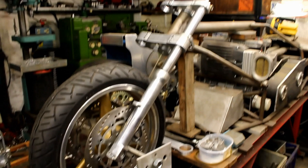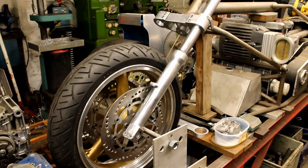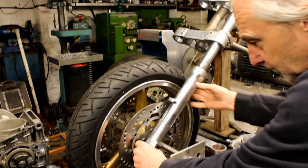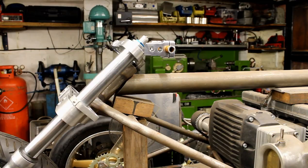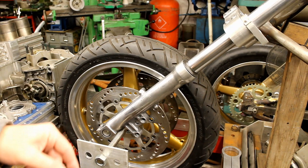The current angle isn't correct - it's just sitting in there loosely. Looking at it as-is, the wheelbase is about 98 inches, which is probably a bit much. With the 45 degree rake that's wrong, but once corrected and the front end moved back two inches it'll come down to around 96 - possibly even 94 inches. The wheel currently in there is a polished ZX unit, but the final wheel will be the billet one which is over there, halfway finished.